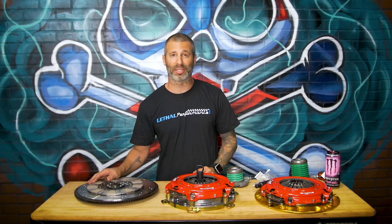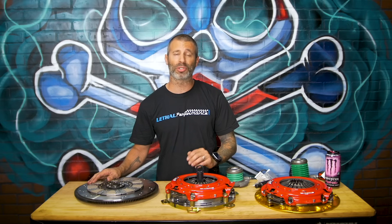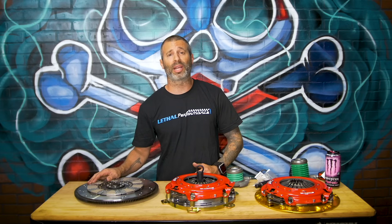And eventually you'll end up having to buy an RXT anyway. So the RXT we rate pretty much even up to close to about a thousand wheel horsepower. We've used that application on our GT500s, on our 5.0s, a bunch of our manual cars that we beat the snot out of. That clutch holds up very well — it will handle the heat and will handle the beating. So if you're forced induction and you plan on taking it to the track using sticky tires and want to beat on it, go with the RXT.